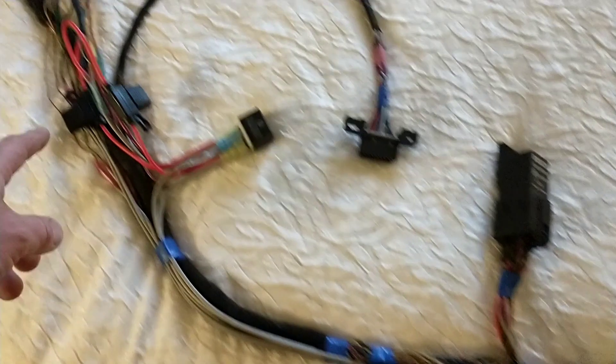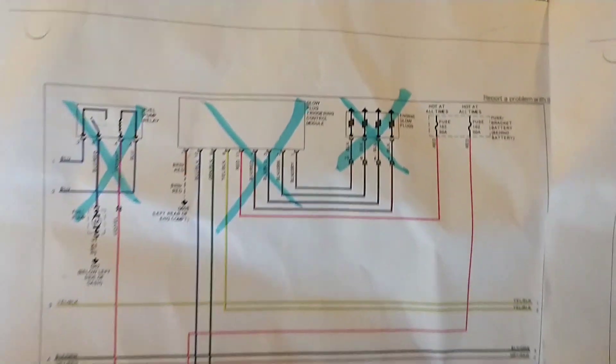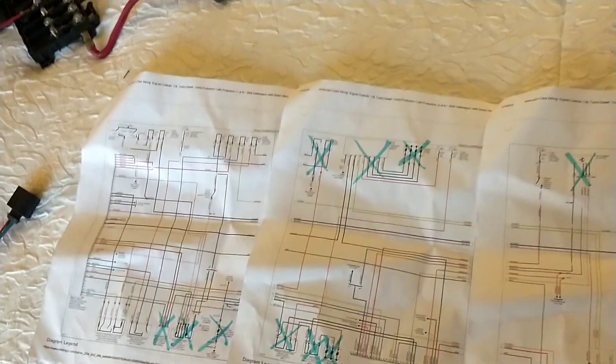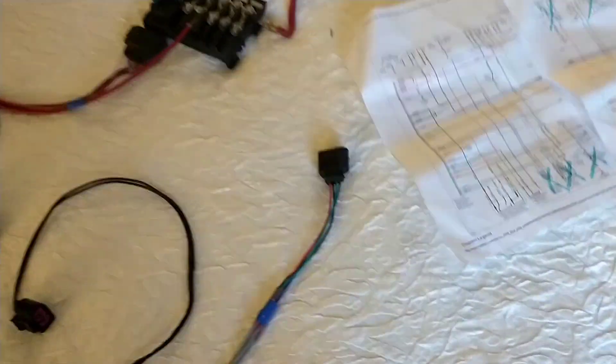There are a lot of little wires going to all the sensors. There are two control wires — a green and black and a blue and black — that come off and go straight over to the ECU. If you're following the schematic it will show you what all that is. You can see right here the blue and black and the green and black going to those two pins on the ECU.